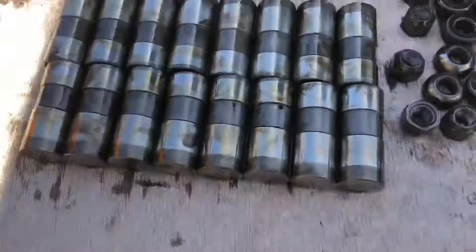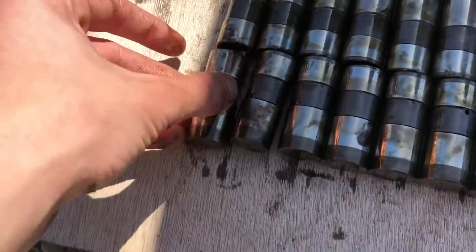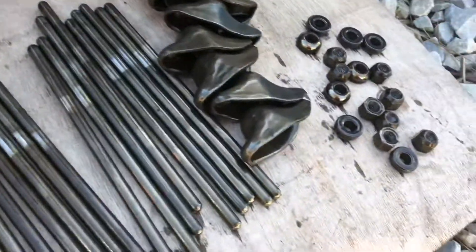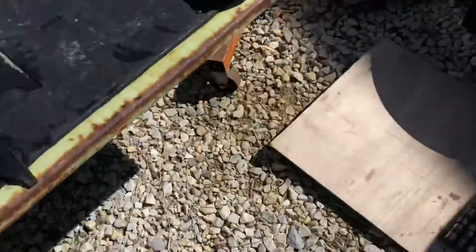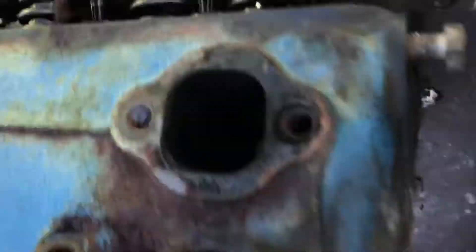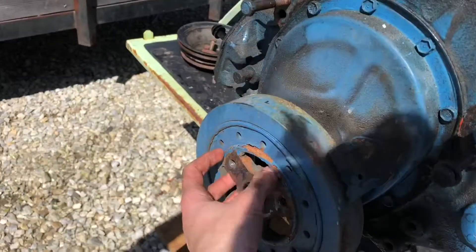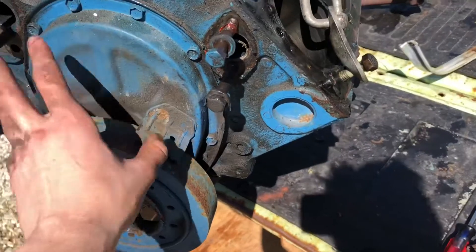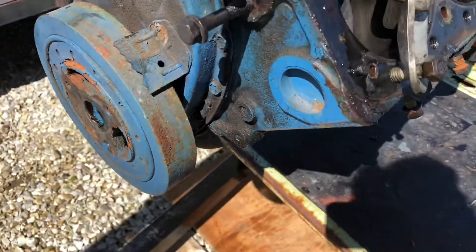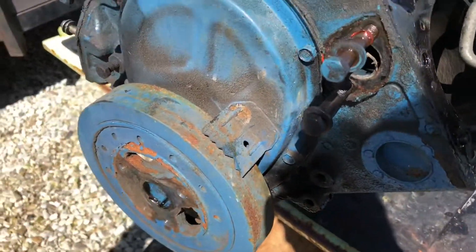Once again I am very impressed by how clean this engine is. And this can't be the original valve train - somebody must have been in here at some point, because there's no way this stuff is 40 years old. It's way too clean. So I somehow managed to get this thing on the hoist by myself. Now I'm gonna go ahead and pull the balancer off, take the cover off here. To do that I have to loosen the oil pan bolts to drop the oil pan down like an inch or so to get this off. And then we'll go ahead and pull the cam out.